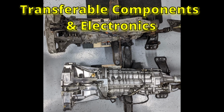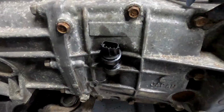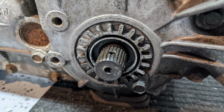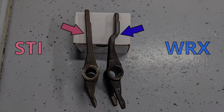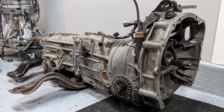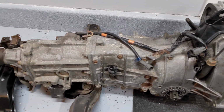The list of external components that are the same between the 5 and 6 speed is pretty short. The vehicle speed sensor, the oxygen sensor wiring, and I think the stub axles. I noticed that some of the bolt-on components like the clutch fork and basic shifter components are also different. Now will they work if you transfer them? Maybe, but I'm just saying that they're not the same. Now unless I get a sponsor for a transmission, I will most likely use my WRX transmission in Dirty D, so I didn't take anything off of it for this swap.